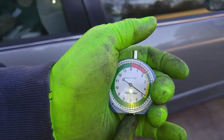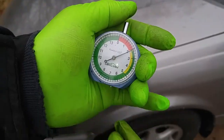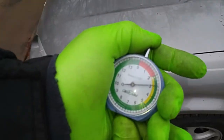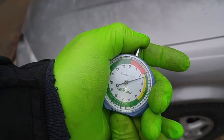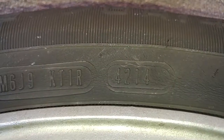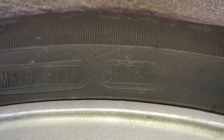This method of tire rotation based upon tread depth should be based on tires that have acceptable tread depth, not worn out. Anything in the yellow zone is okay. When you're approaching the red zone, start thinking about replacing the tire. If the tire has unacceptable tread depth or the tire is over six years old, the tire should be replaced. You can determine the age of the tire by looking at the date stamp on the tire.